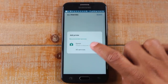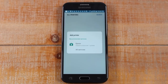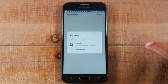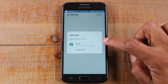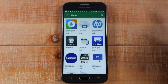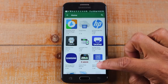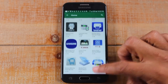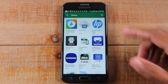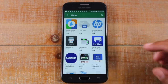The phone is telling me it recommends that you download this Epson app, because that's going to allow the phone to link with that Epson printer. So we're just going to tap on that. Now if you didn't have a recommendation here, then you would need to tap on All Services. You would need to find the brand of printer that you have — so if you had a Canon, you would go to the Canon app; if you had HP, you'd go to HP. You need to install the correct plugin that will allow your phone to talk to the printer.